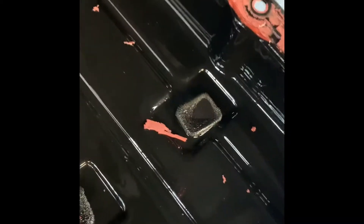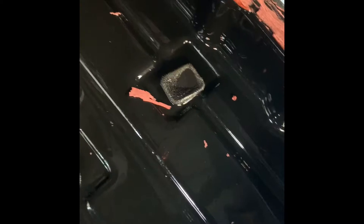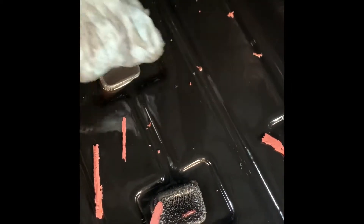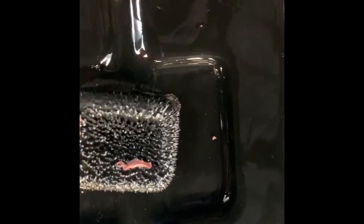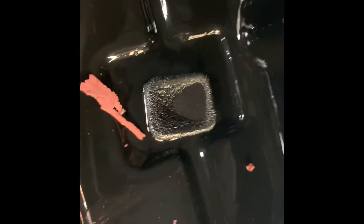On the bottom of the pan, take a look inside — you will have these magnets right here. You can clean them off and remove all the metal particles that get trapped from the transmission so they don't get recycled back through. If you see all those little spikes on the magnet, that's actually a very low amount — not too much wear. If you see a lot of that, that's when you're going to get a little scared.